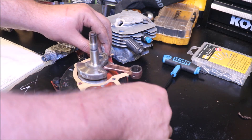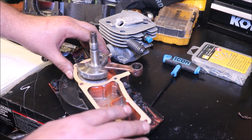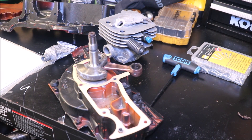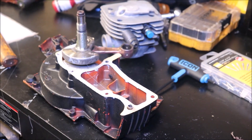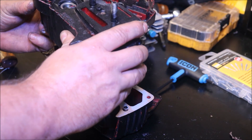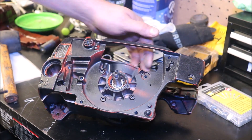Whoever has got those gaskets cut, the tolerances on them were pretty dang tight. So what I'll do is I'll put another film on top of that and heat the bearing up a little in the other case and hope she goes right together as easy as that did. We have six bolts in here.